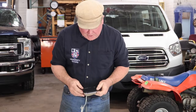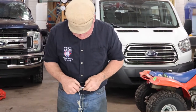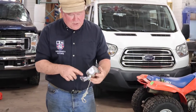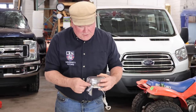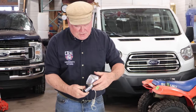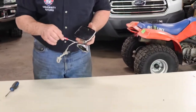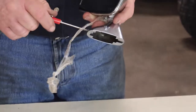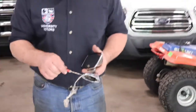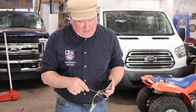So this isn't too hard to get back into place. There we go. And assuming that we loosened all this stuff up down here, we can get this all nice so that it adjusts easily. The screw that's in the end here is a 7 by 1 metric screw, and once it's in place, you usually can't move it. It goes into a wedge that holds it on the door. Usually you can't move it again.